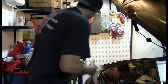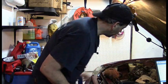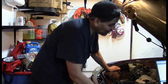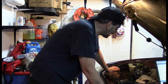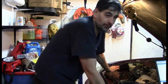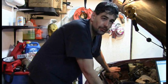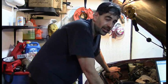We're at the end of our 15-minute run. Without question, both heater hoses are warm, so I know the thermostat is open and the product cycled through. I have to admit, it sounds to me like the idle is a little bit better — though maybe it's just because the engine has warmed up fully. The idle definitely doesn't sound as rough. I'm going to go ahead and turn off the car, let it cool overnight, and then tomorrow morning we'll do our tests to see if this worked.